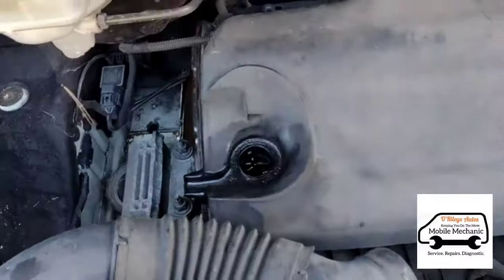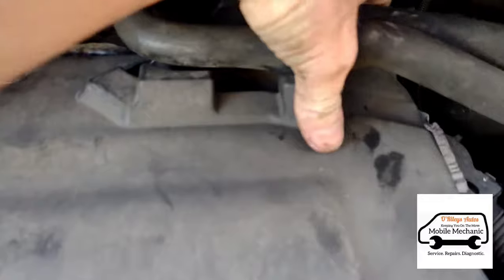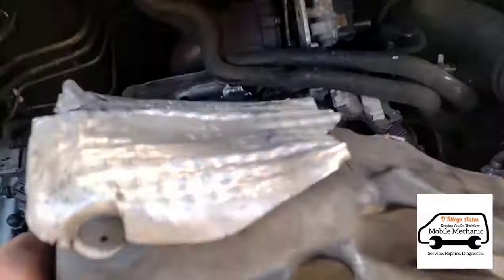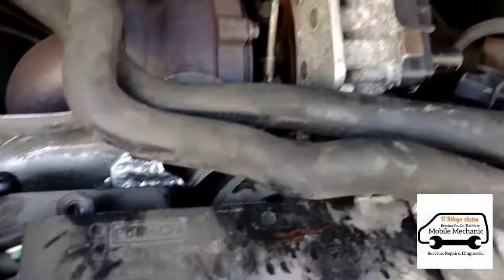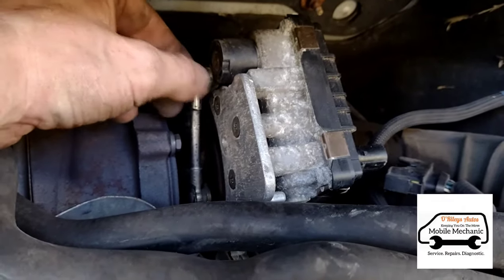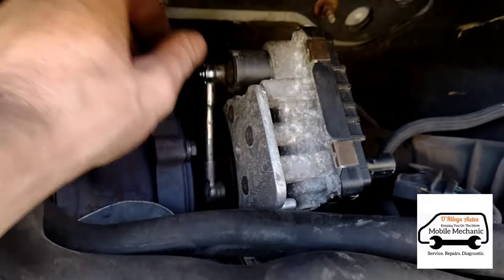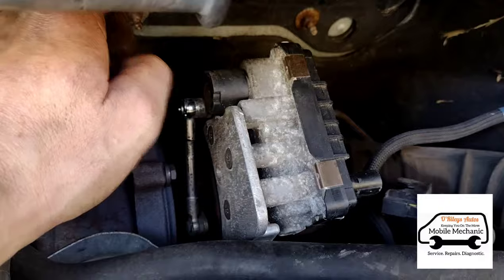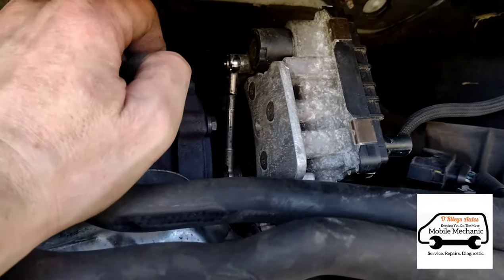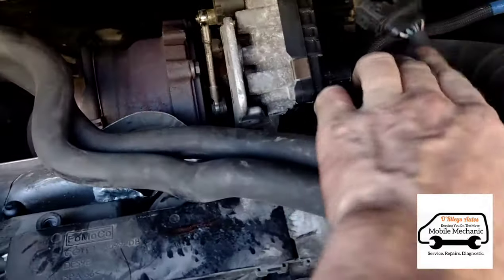Pull this up, you can get that out of the way. Remove the oil filler cap and we can get the rubber engine cover off — just unhook these tubes so we can get it out. Now we've got a little horseshoe clip on the back of the rod here. There's a lot of play in that — it's like the gears have broken inside. There's the horseshoe clip, and we've got three T30 Torx on the back here. On the plug you've got these two little clips — press either side to pull it out.